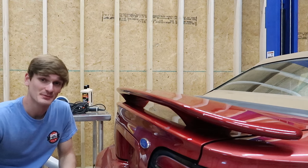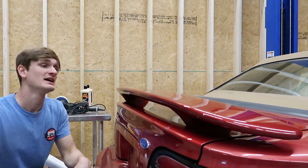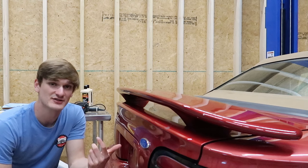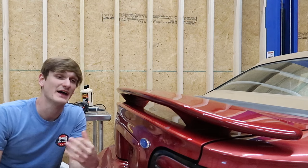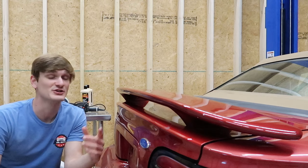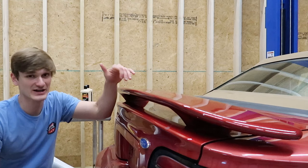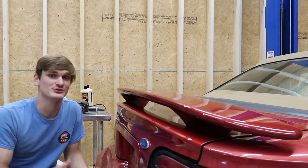The way that you sand the panel is extremely crucial to the finished product. So if I'm using 2000 grit sandpaper on here and I did a perfect job, it's going to polish out perfectly. There's not going to be any scratches left over from the sanding process at all. However, if I use that 2000 grit and I make a mistake with it and I dig into the paint using way too much force in an area, that 2000 grit scratch would be equivalent of a scratch of, let's say, 800 grit. So when you polish it out, yeah, you're going to remove all the 2000 grit scratches, but you're not going to remove that 800 grit scratch, and there's going to be what's called strays or stray scratches that are going to be left around there. That's why it's so important that you make sure you do the sanding process correctly, which is what I'm about to take you through.